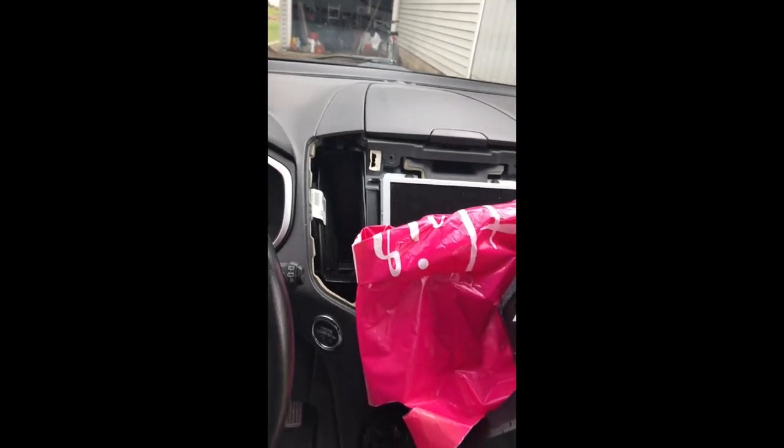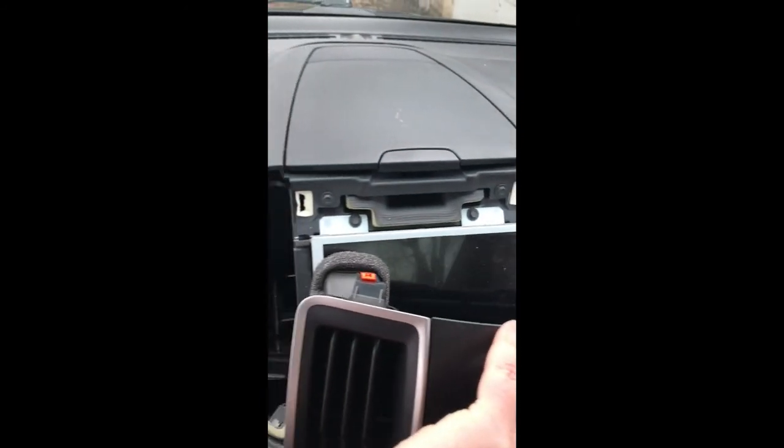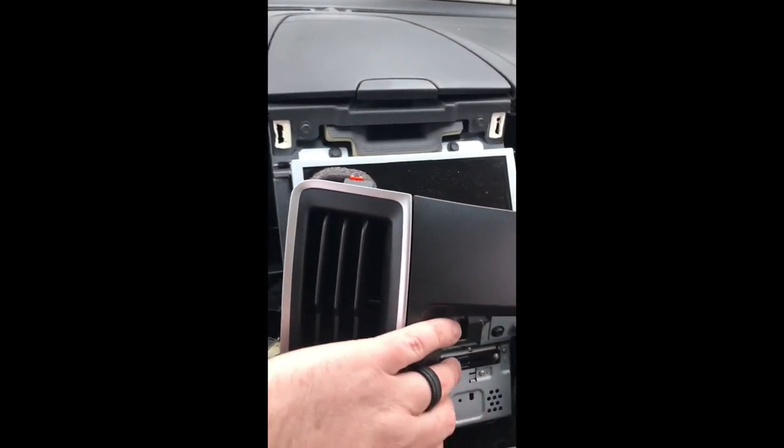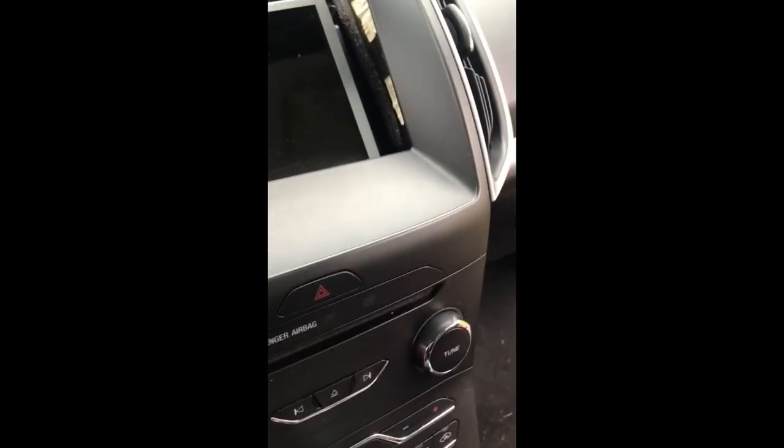Don't put coins in here — that's where the coins will fall through. Now to reassemble the rest of this. There are some 7mm screws holding the little top on. Going backwards from the way we did it before — just make sure you re-clip everything back together, otherwise the car computer will beep at you. When you're reassembling this, there are these orange pins that have to go into their little notch first, and then the rest of these plastic pins can all get pushed together.